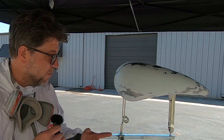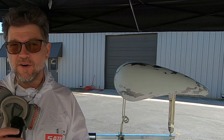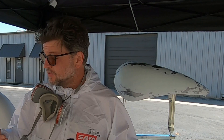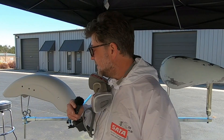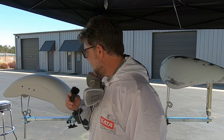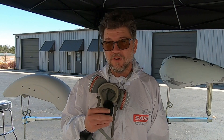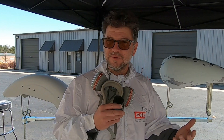You can see there's been some filler on this. Last time we were here, we reviewed one of the SATA primer guns with a 1.4 nozzle and we sprayed on an epoxy primer inside and out on the fenders. What I've been working on since is basically just blocking it, getting everything smooth, and then going back with some body filler. The fender was actually very straight and required very little work, but the tank did take quite a bit - it is a custom-built, hand-fabricated tank, not pressed. English wheels, planishing hammers - sometimes you just got to use a little filler.